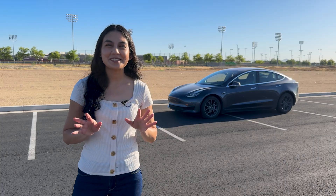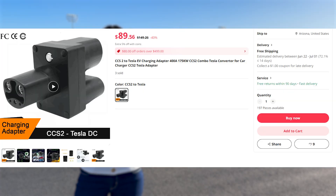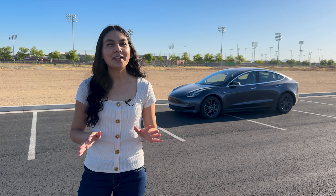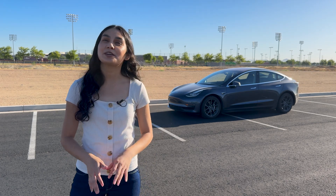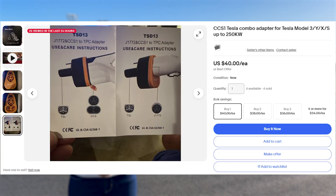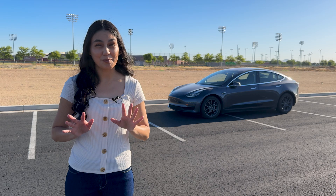Once your car is ready to use the CCS adapter, be careful what adapter you actually buy. Cheap CCS adapters have started to go on sale, and while you might get lucky and find one that's okay, I'd advise you to steer clear. Spending a bit extra to get an OEM or certified adapter is worth it. You don't want to cause thousands of dollars of damage to a charger or your car by trying to save a bit with a cheap adapter. Some of these have blatant safety flaws and should be avoided.